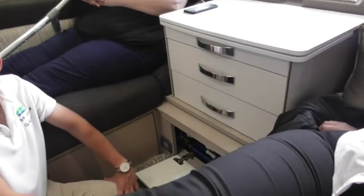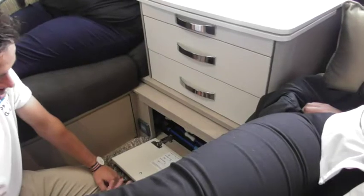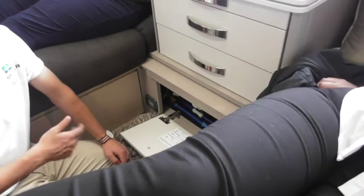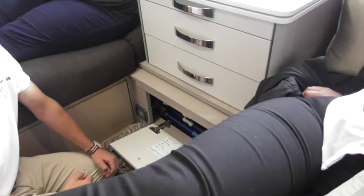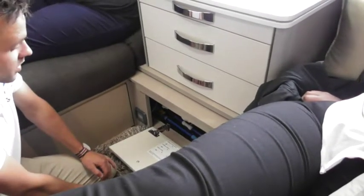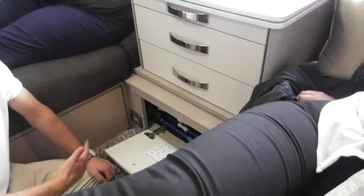So when we leave the van, when we've packed everything away, one of the last things we do is literally the drain down. Just open them both up. The best way to drain it down is to lift those up and open the taps at the same time, like we did the last one. Then it gets the last bit of water through the taps and drains that line out. And then it's travel with the taps open anyway. Yeah, absolutely. You get air in the pipes, but it doesn't really matter because when you drain it down, odds are it's for the end of the season.